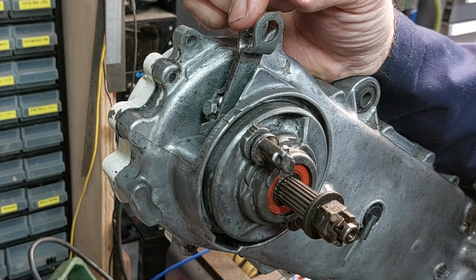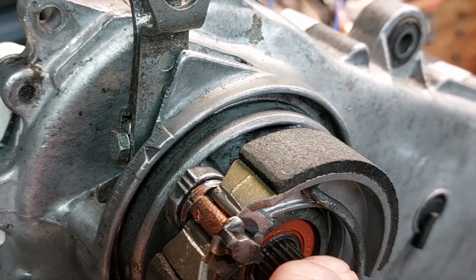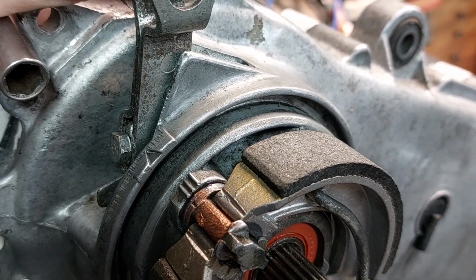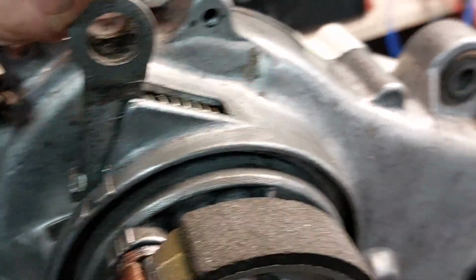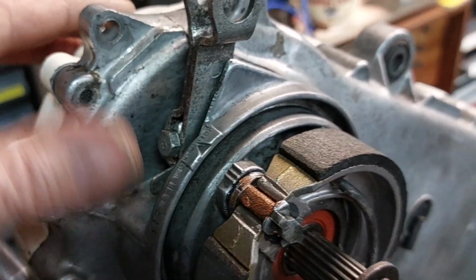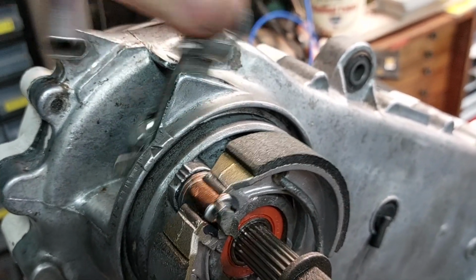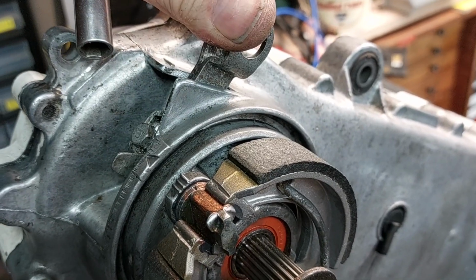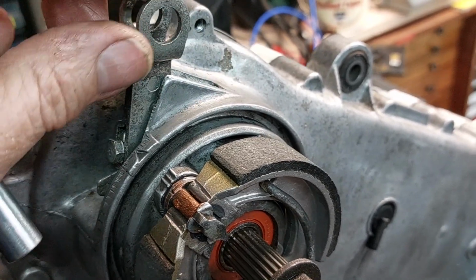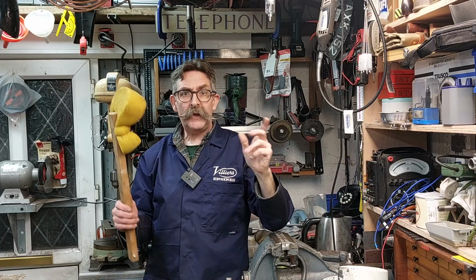Right, I'm going to put it together while Short's not here, because it's going to involve swearing. So there we go, shoes on, lined up with the first mark there. And it's in line there, when that mark's there. Line up there. And then the wear indicator's down there, so it's got a long way to go before we need new shoes. In fact, it doesn't even reach there, so until you move it around 2 splines, it won't use up all the shoes. So that's where we've got so far.